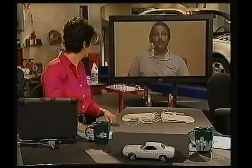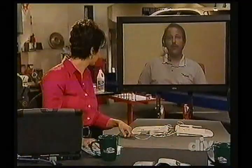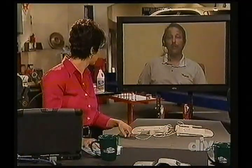The bad news is that since it's normal, there's not a heck of a lot he can do about it. I can give a couple of tips. One would be that there should be an insulating sound box around the outside of the solenoid body. If the vehicle's ever been worked on before or has had any repairs done, that may have been left off, so he wants to make sure that's in place. If it is in place, the only other thing he can do is go to Chrysler and pick up an updated solenoid body that does run a bit quieter if this is really annoying him. But the key point is it is a normal condition and it's not going to create any harm.